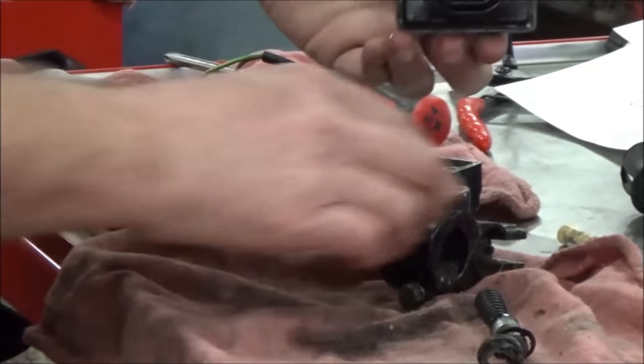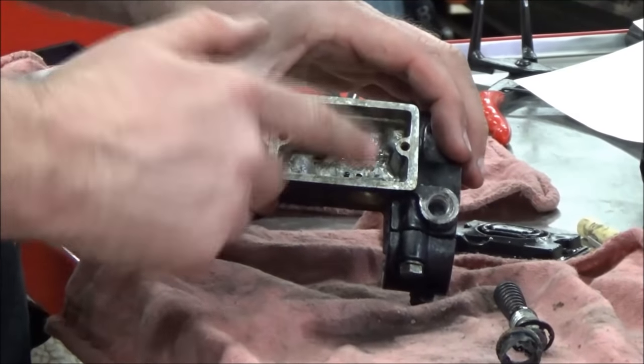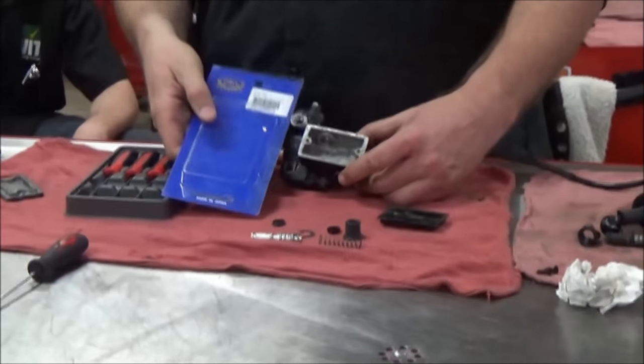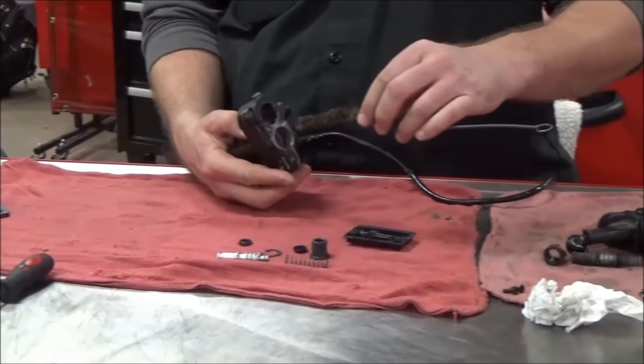This one's stuck. Here's our reservoir - we've got these two holes in there. One is a fill hole and one is a return hole, it's just that simple. We're going to assemble this using a K&L Supply rebuild kit. We've gone ahead and cleaned this really well - you could take some brushes and put it down the bore.